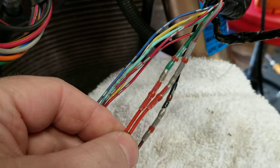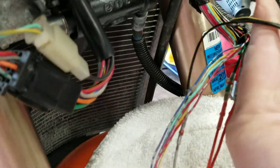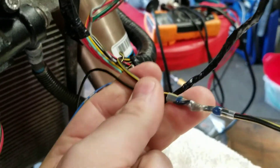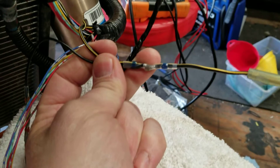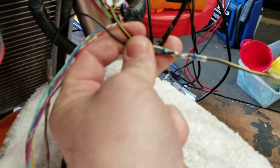You're going to solder and shrink wrap them together. Then that black wire that came down from the gray up top is going to go all the way over here, and we just chopped into one of the harness grounds over here and merged it with one of those little connectors that we did.